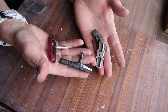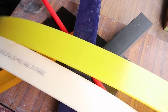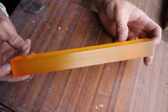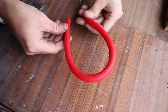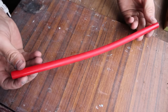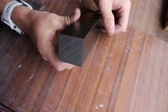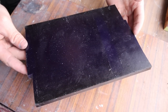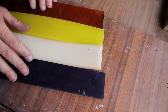So that's the backings covered, but what about the braking material we'll be using? I've spent years buying and testing different materials and come to a couple of conclusions. Firstly, I settled on polyurethane being the best type of rubber, as it's got great abrasive resistance and is generally strong, so it won't shear or tear. Rubber hardness, or durometer, was the next thing I tried to figure out. The hardness is measured on a Shore scale, with lower numbers being softer and higher being harder. There's also a letter scale, with polyurethane most commonly being either Shore A or Shore D — A being more rubbery, and D being more plastic-like. I found polyurethane between Shore 80A and Shore 90A to be the sweet spot, with 85A being my favourite but 90A being a close second.